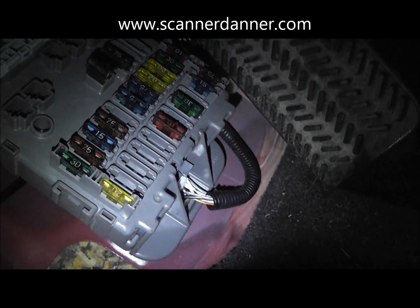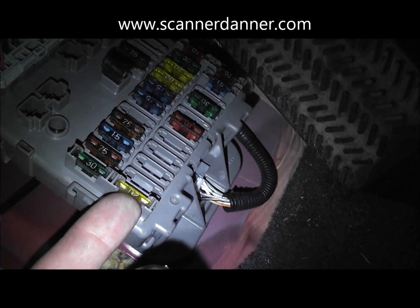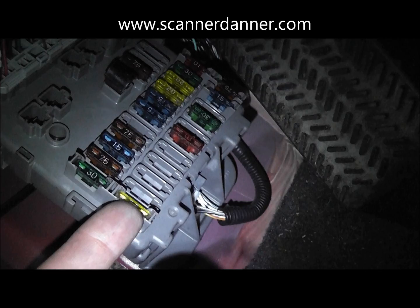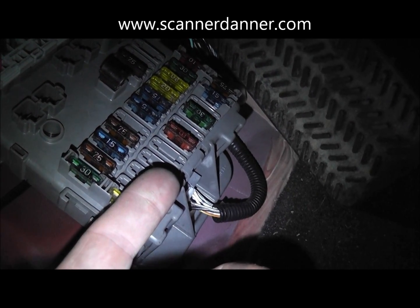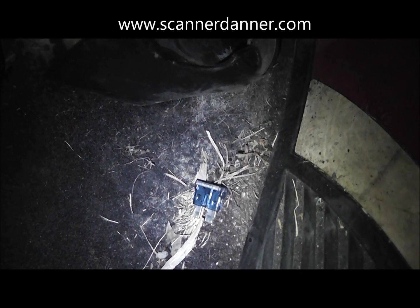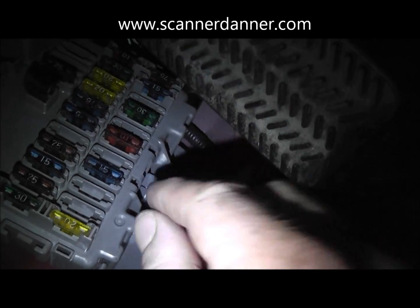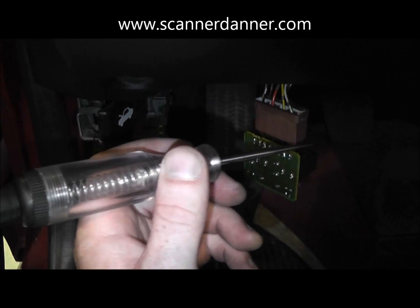What I thought was going to be a nice lesson on fixing a solder joint on a main relay turns out to be a fuse issue. This no-start problem was not intermittent - this is the first time it was a no-start, so I gave you some bad information there at first. Counting these fuse numbers: one, two is missing, three is missing, four - there should be a fuse in number four. That goes to our main relay on the white with green wire; it's a 15-amp fuse, and there's a 15-amp fuse laying on the floor right there. Apparently somebody kicked that fuse out.